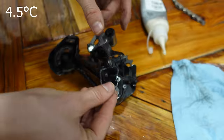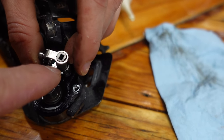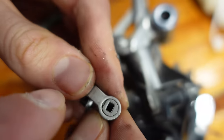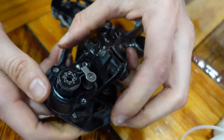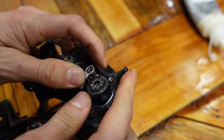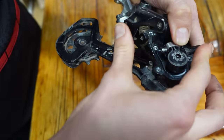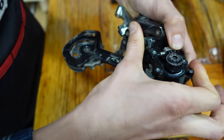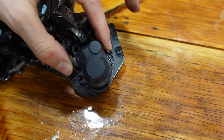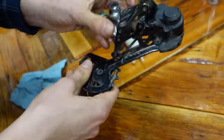See how it's not symmetrical — it's not circular. When you turn the clutch on, the wider part should be pushing down and squeezing. I think this is 180 degrees off — that little gap at the bottom should be facing down. That piece has to be held in place by its cover, so pretend to be the cover if you want to test it. On — yeah, that felt a lot better. It should move more smoothly when that's on and you rotate the cage. Way better, way smoother — before it was catching. Let's put the cover back on.